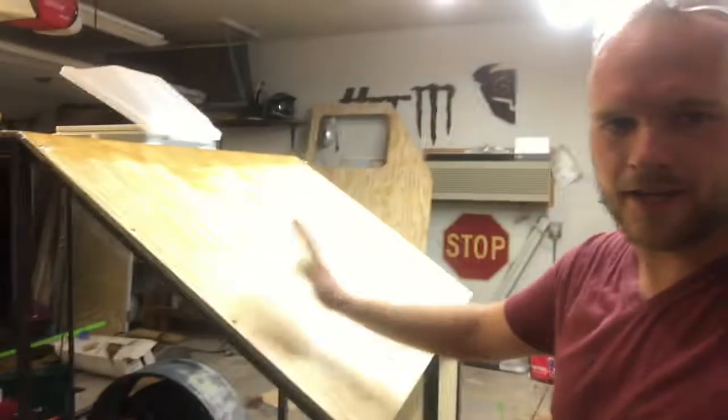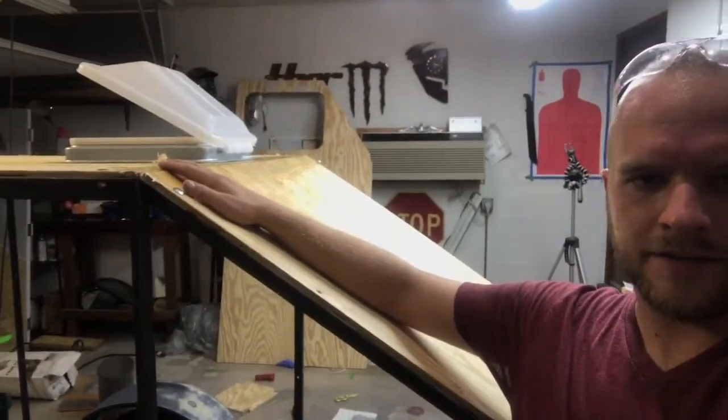Alright guys, I want to apologize for the lack of video today. The face panel did get on. It's kind of whitewashed in the camera for some reason — it gets really dark when I do it. It is looking good, coming along real well. I put a strip of fiberglass woven mat right here so I can have it set where I need it to be and then route it out without the bolts in place. This trailer is so out of shape that I need to clean up some areas, but my wood is cut to square while the trailer is not. I want the wood to fit the trailer, not the trailer to fit the wood — so it's just having to work the opposite of how you normally would.